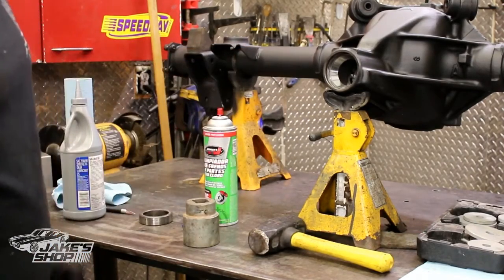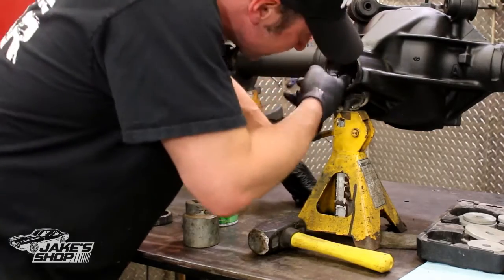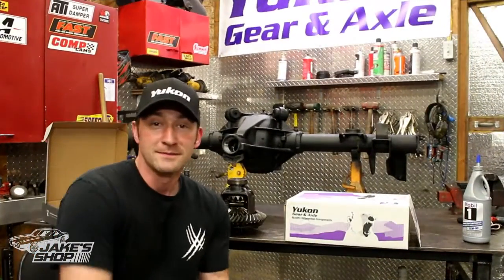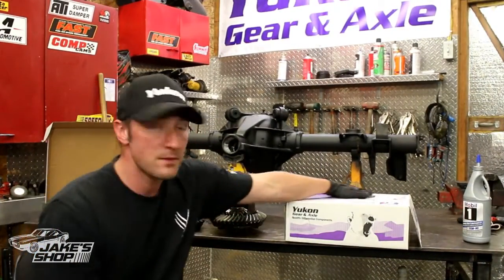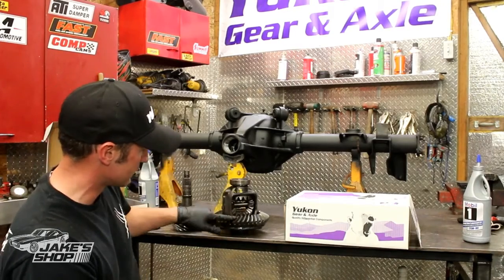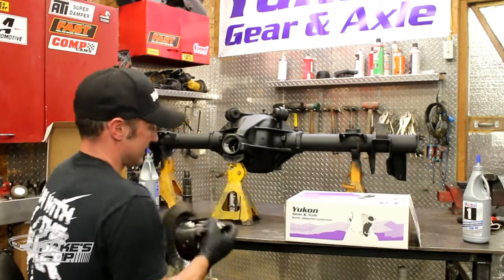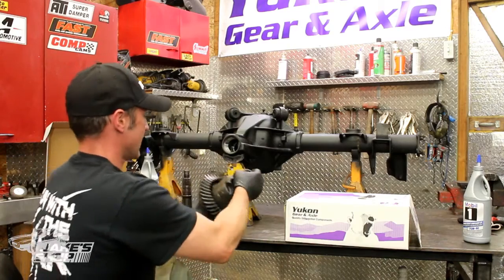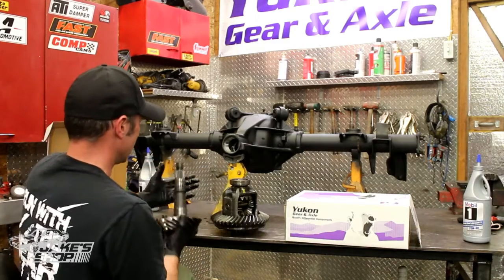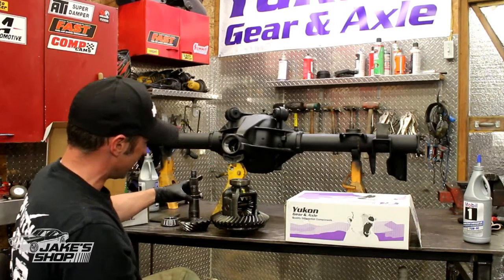Now, when I go to set the pinion, I'll do the initial torque on it and it might set the races a little bit. On inspection they look nice and completely tight to that back edge. Some toys — get to open some more boxes. The next thing I'm going to do is go ahead and set up the carrier. The carrier I'm using is a Grizzly Locker — I'm not using the original carrier. There are two main shim packs: the shims that hold the differential itself, shimming each side, and then the shims in between the pinion and the front pinion bearing. We've measured this pinion bearing and we're going to start our initial setup with that pinion bearing.